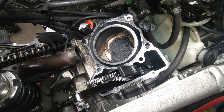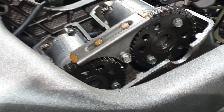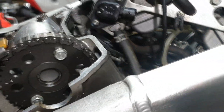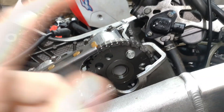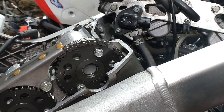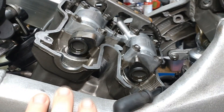I'm going to spend some time cleaning off all the old gasket and put the head gasket on. So the camshafts are in now on the rear — I've set the timing up and I'll just explain how you do that. The front and rear have to be synchronized in the right timing basically. So on the front cylinder, if that's at top dead center, you'll have FT in the timing window.